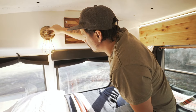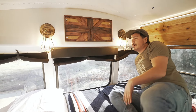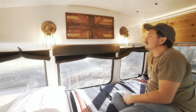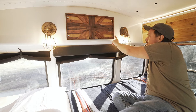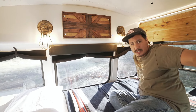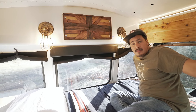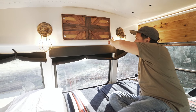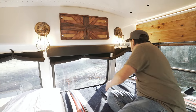These were holes from the AC unit where the tubes came in and out — two big old holes — so I put some 12-volt fixtures over those to cover them and have some light back here. These are on their own switch in the bedroom. The cool thing is I can have the lights in the whole bus on, and when I'm getting ready for bed I come back here, turn these bedroom lights on, turn the bus lights off, and when I'm ready to sleep I just press this button without getting out of bed.